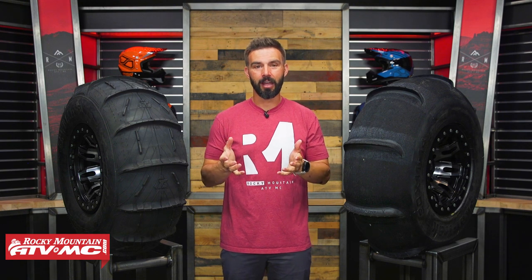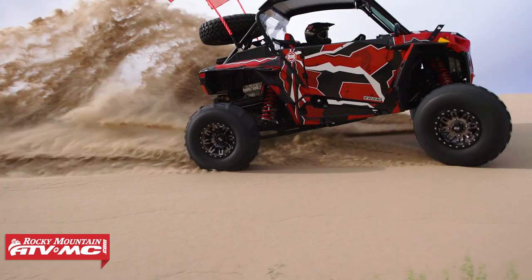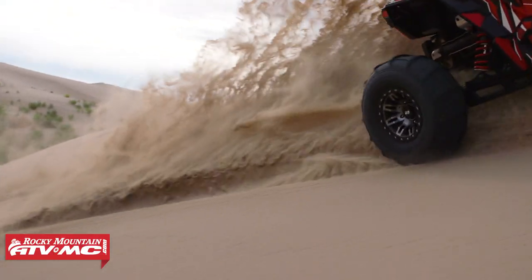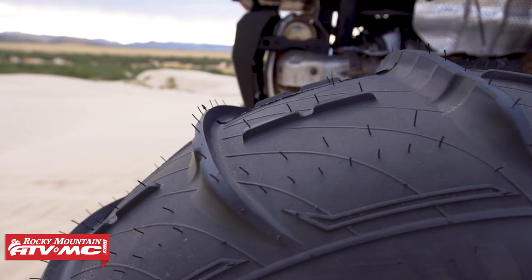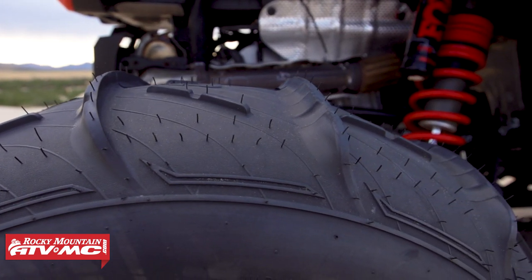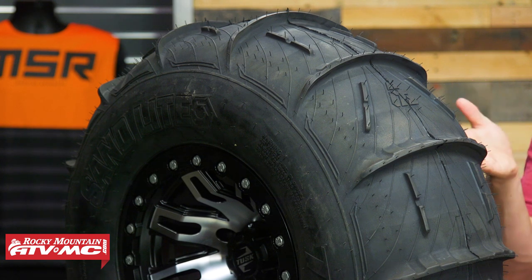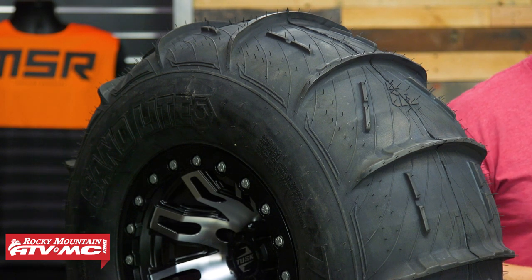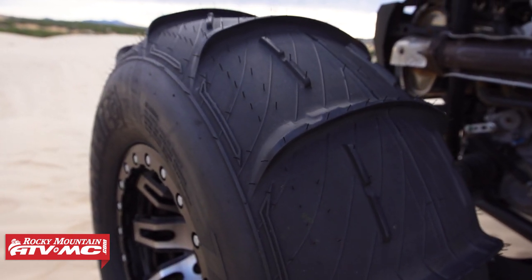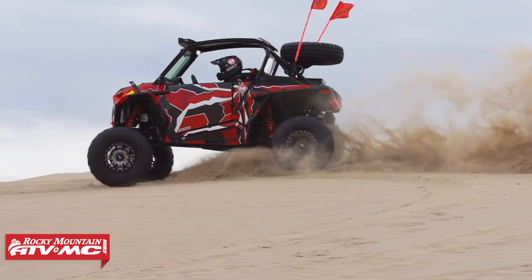The next topic — probably the most controversial — is paddle count. There are a lot of opinions about how many paddles are ideal depending on your setup and where you ride. You can see paddle count anywhere from 8 all the way up to 15 or even 16 paddles on a sand tire. For example, this Scat Track has 9 paddles and is a 30-inch tire, while this Tusk Sand Light has 14 paddles and is also a 30-inch tire. No matter what machine, you want a good blend of paddles digging in for forward drive, but also a good blend of wheel spin — and yes, you do want your tires to spin a little when you accelerate, because that allows the engine to spool up and build power.